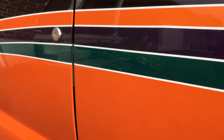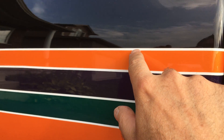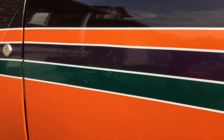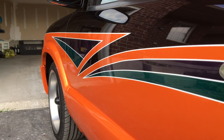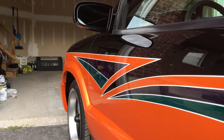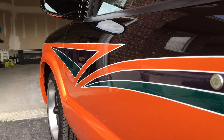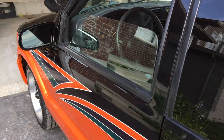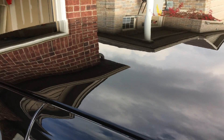Got a lot of the feeling out of it. You can still very faintly see a little edge line where it's not fully flat. So then we taped it back up, put it back in the booth, and did another three heavy coats, then let it sit for a good month. Put the car back together, finally got it out of the shop, got it to my son's house, and let it sit outside in the heat to bake really good.